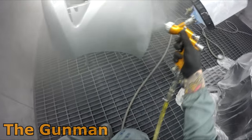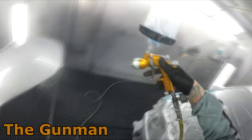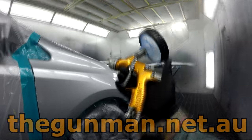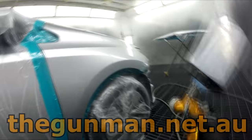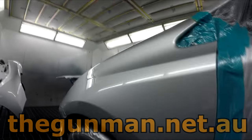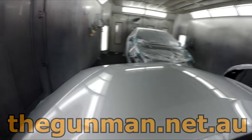The CC6400 clear I'm using here is absolutely amazing — it's a VOC clear and we use a performance agent in it rather than a reducer, which is basically a solvent that would cause more emissions when it evaporates. Five and a half minutes for the clear coat on this Toyota Corolla. Devilbiss GTI Pro Light, TE20 air cap, 1.3 mil, four turns out on the fluid, two bar pressure with the trigger depressed and full fan.